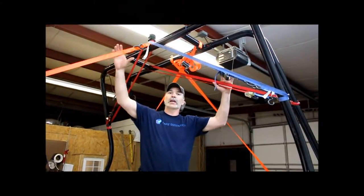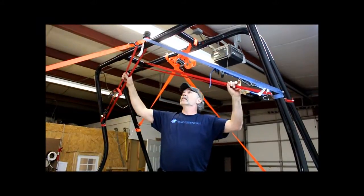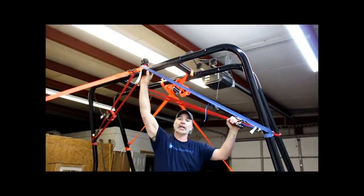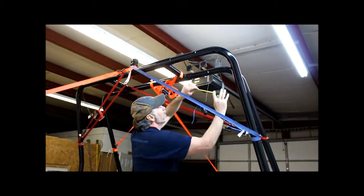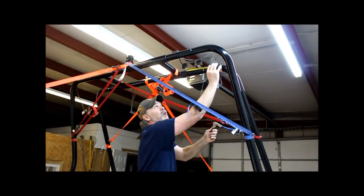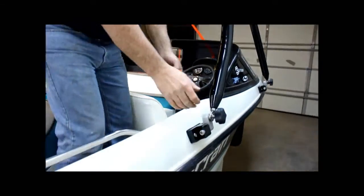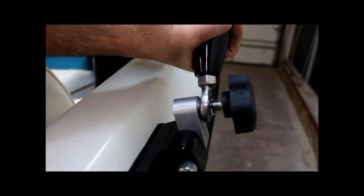Now we're on the preloading part. I know it looks crazy, but I promise there's a method to my madness — this is where the big air towers get their strength. I've got a ratchet strap on each corner of the tower running over to the H-member. This is where the white mark comes in handy: you measure from your H-member over to the white mark, then using your ratchet strap you pull it in until it's even on the other side. Once you've got all four corners done, you check them down at the quick release — give yourself a little space and you want about 20 pounds of pressure to pull that out.